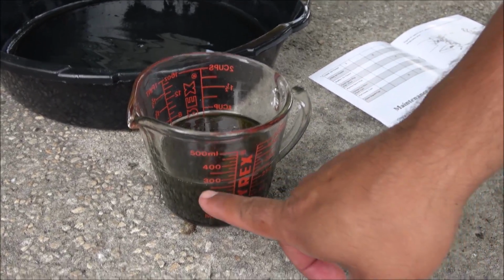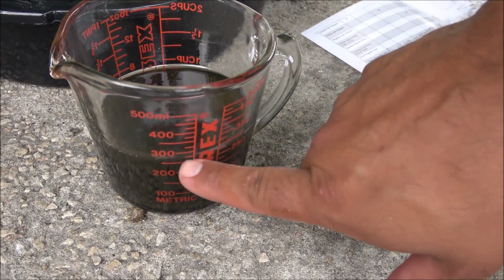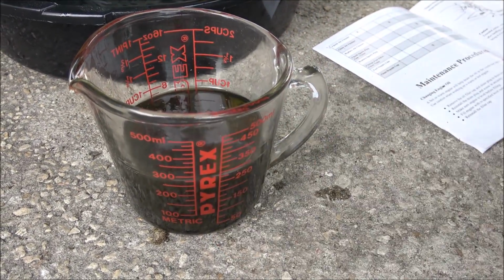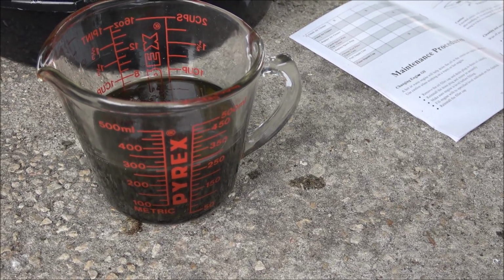And just to show you, before I went with the dipstick to know if it was full or not, this is how much oil I took out from the engine. So it was about correct, again, 300 milliliters or 0.3 liters is what you need for this motor.